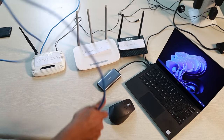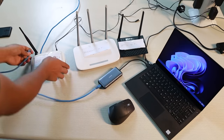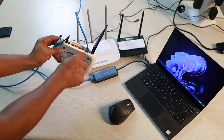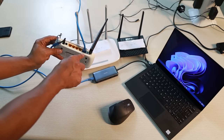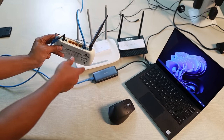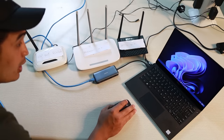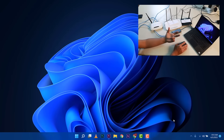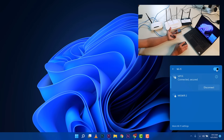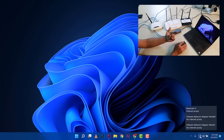I'm going to plug this cable to my laptop. Now, you can see the blue port — it says WAN or sometimes labeled internet. That's where they plug the internet in. We are not going to plug it there. We are going to plug it into these yellow ports, which are the LAN ports. Now that I'm in my laptop, since there are other Wi-Fi connections here, I need to turn Wi-Fi off. You can see that I'm connected via LAN cable.